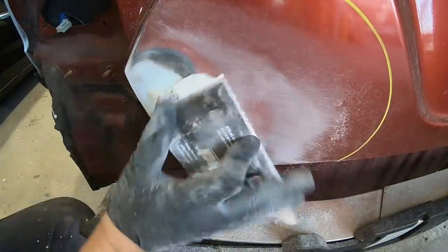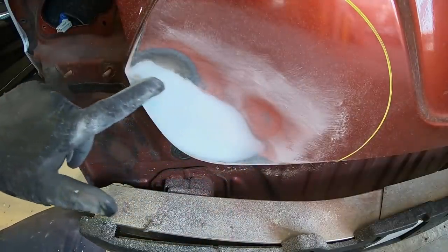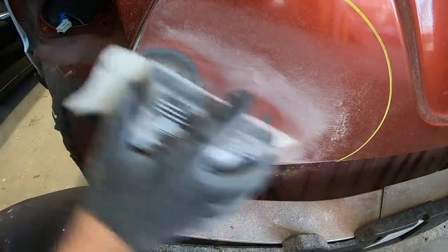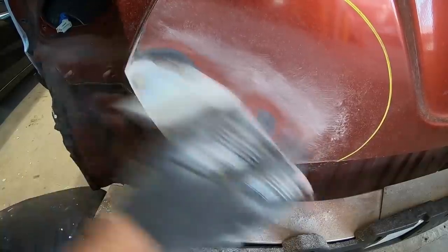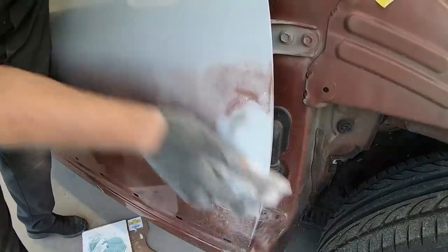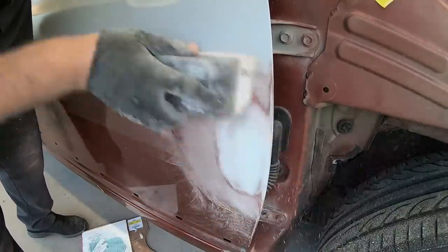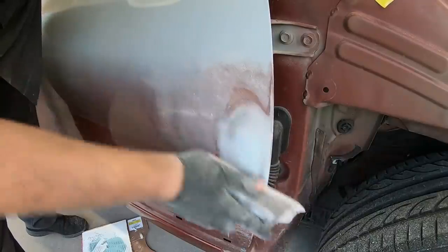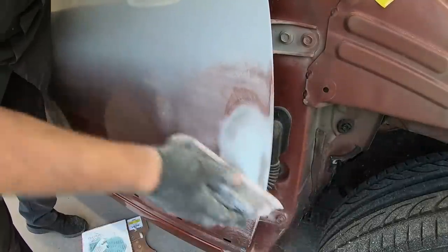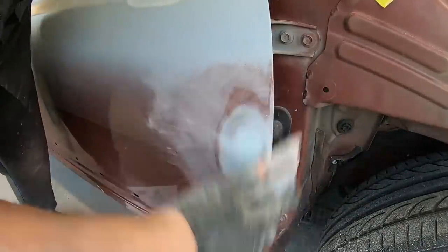I can already tell that this is looking really good. Now how do you know when to stop? We know when to stop when we look at our edges and can see that they're starting to feather in nicely, and on the next step I'll show you how we use a guide coat to know if all the scratches are gone. Moving on to the door — same thing, we have a 45-degree angle here and a 45-degree here. We're always looking with our eyes, making sure there are no pinholes and everything is sanding nice and flat, because you don't want to see all of this after paint. Take the time now to do the repair as best you can using all the knowledge you've gained. This is looking good.